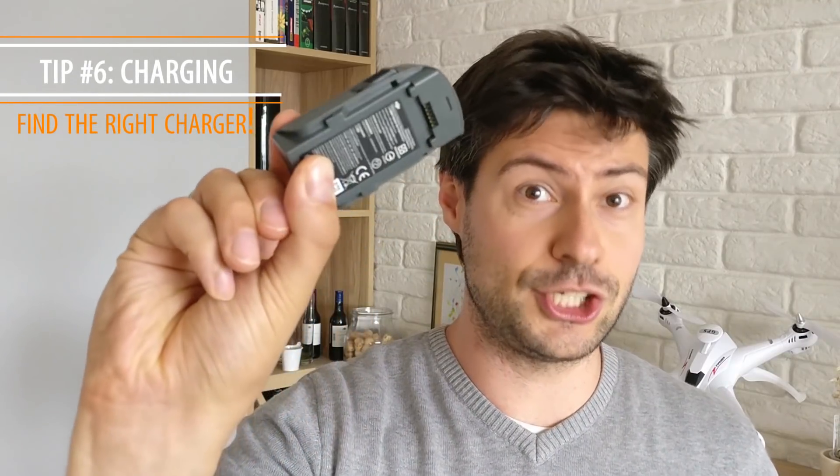A quick piece of advice for charging: the original DJI Spark battery operates at 11.4 volts. When I got the drone I hoped to charge it from my OnePlus power bank, but it didn't work. Most power banks output 2 amps, which is insufficient — the original DJI Spark charger outputs 3 amps. There are power banks supporting 3 amps or Quick Charge technology that can charge the battery. If not, you need a step-up converter, since USB standard is 5 volts while the battery requires 11.4 volts. Also note the battery is 1,400 mAh and 3-cell, so your power bank needs at least three times that capacity to fully charge it.